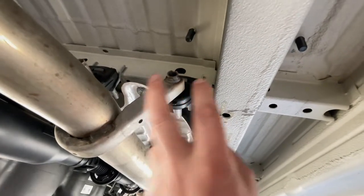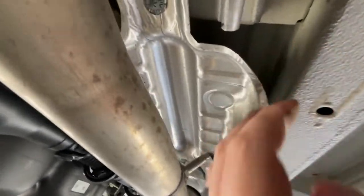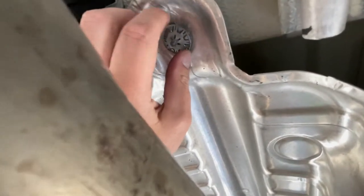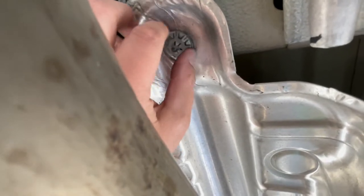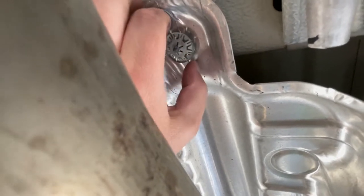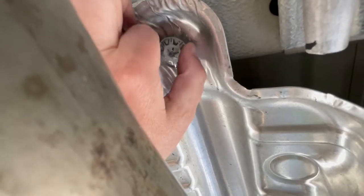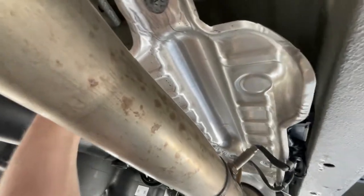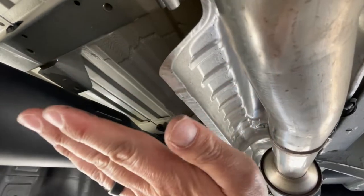Okay, so some of the bolts for the front of the passenger plate are going to come down right above this heat shield. And there are some little retaining, I don't know what you call these things, little clips. Once you get them started with needle nose pliers or a screwdriver, they do unscrew like that. If you apply much pressure at all, though, they won't come off. They'll skip threads. So you kind of have to gently pull and twist. And the idea is once this is down out of the way, I should be able to get up in here from the other side probably to be able to attach the backing plates and hardware.